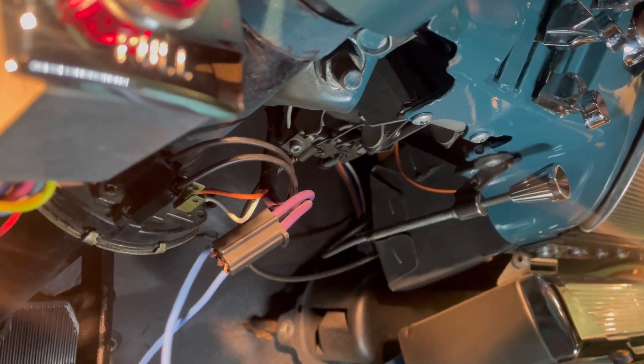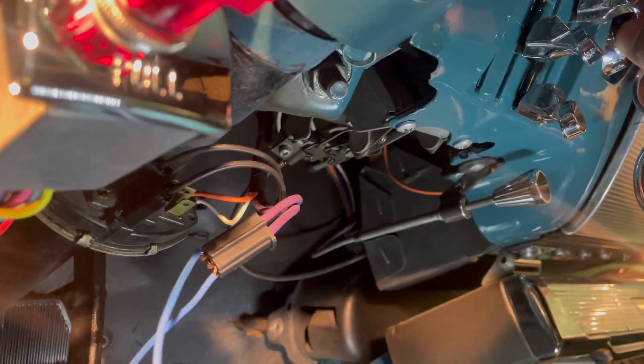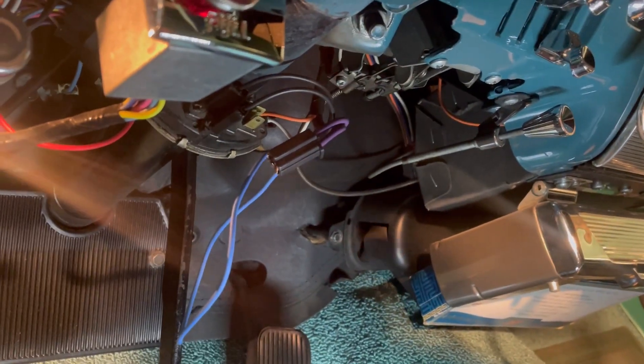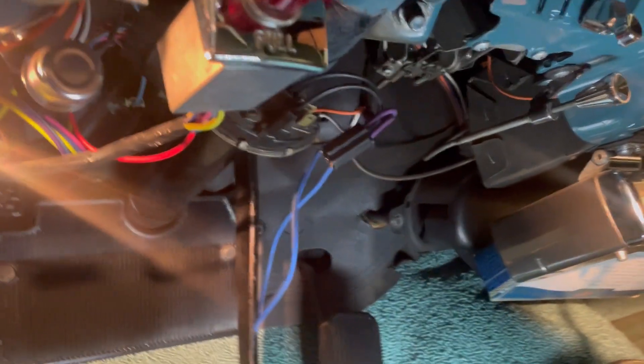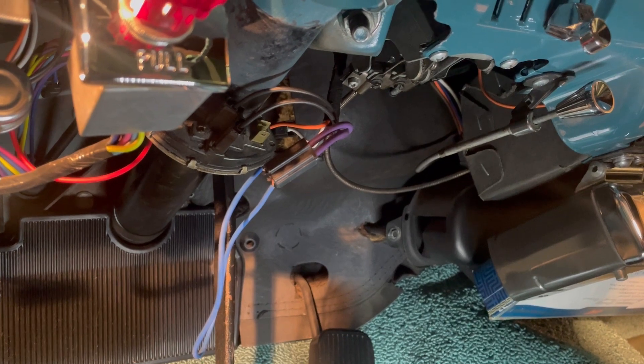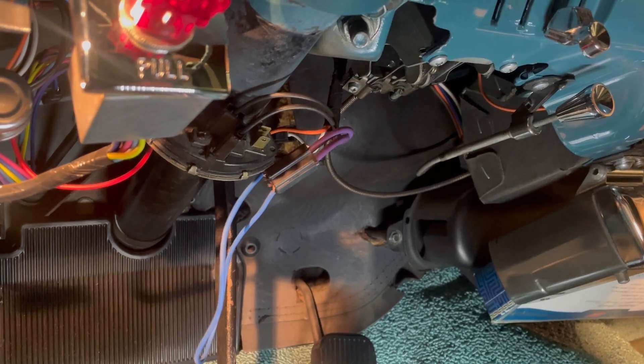There you go — it's starting. Battery's a little low but that's not the issue. That's the gist of the concept: bypass the neutral safety switch by jumping one wire over to the other to complete the circuit for the power. That's how you can diagnose if your neutral safety switch is bad or not.